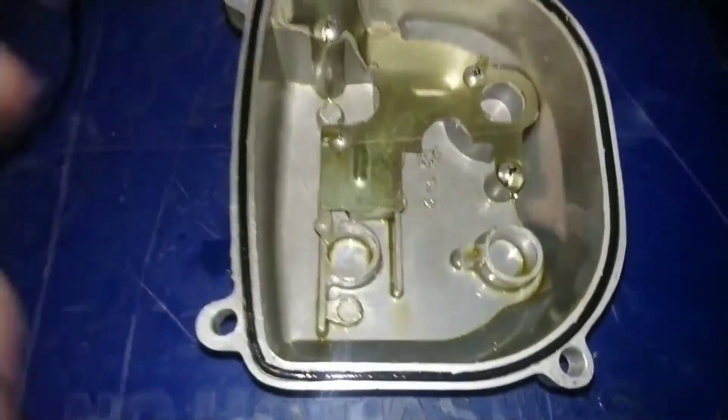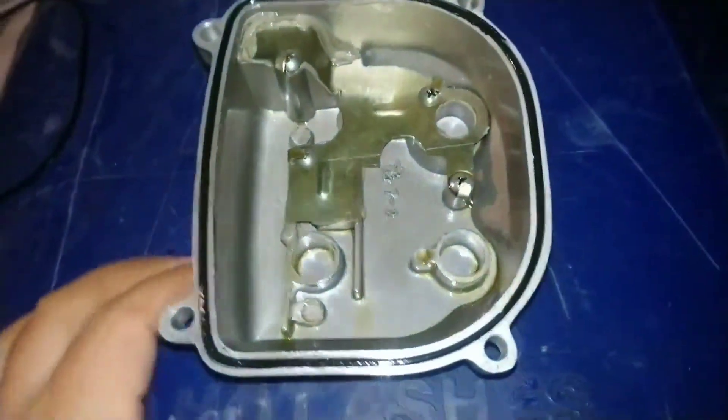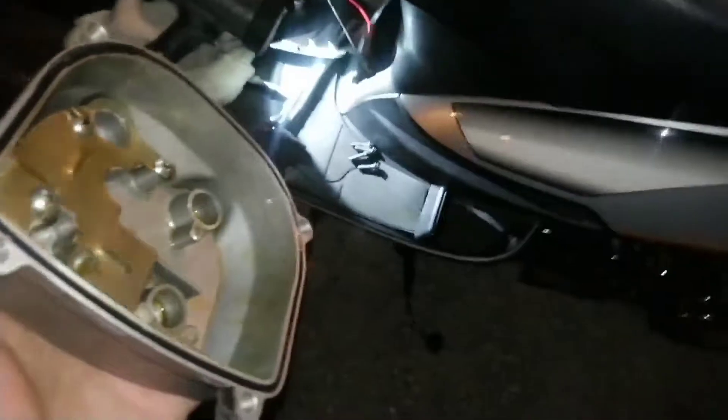I've lined up the old gasket and put the new gasket on there with fresh oil around it. Get ready to insert this back into the scooter — I believe this side goes up, so I'm just going to press that back on there and put the four bolts back on. Really simple job. Go ahead and slap this back into place.